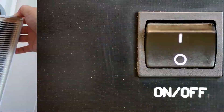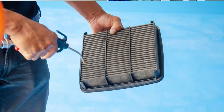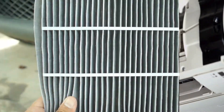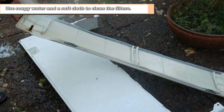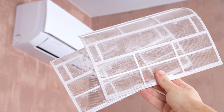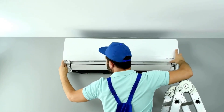Reusable air filter: switch off the power supply. Disassemble the front cover. Use a vacuum brush to clean the slats. Gently remove the air filter and shake it gently to dislodge any dust. Use soapy water and a soft cloth to clean the filters. Rinse the filter in clean water. Leave the air filter to dry and secure it back. Secure the front cover and test your unit.